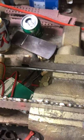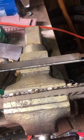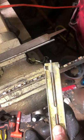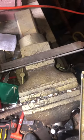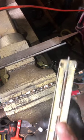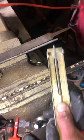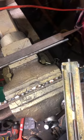So anyways, there's our colored tooth right there. We're about right down to here. We're going to lock it, and then we're going to get to filing. Down there in that gullet, you can see the angle I'm at. You want to keep that consistent angle. There's the top of the tooth right there. Just wrap right around the top of that file. You're getting down there real nice. Look at that. See, friends? See what I'm doing?